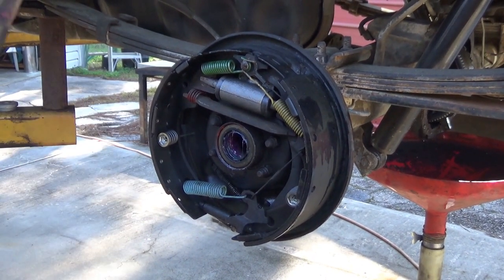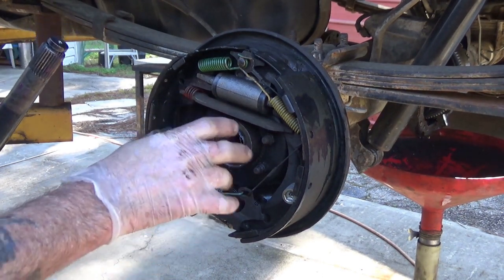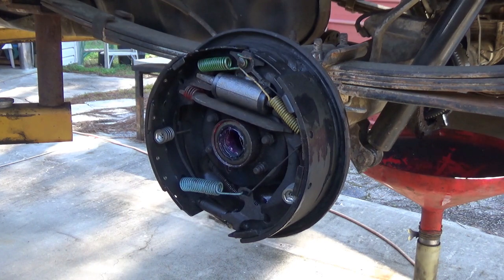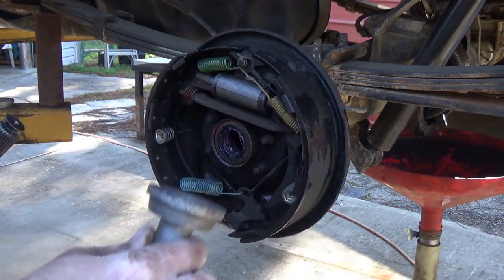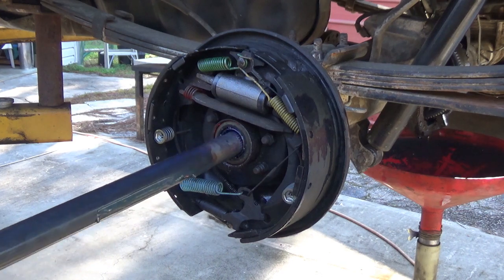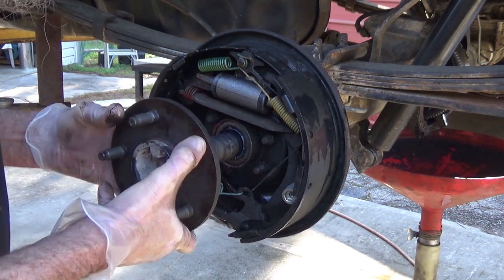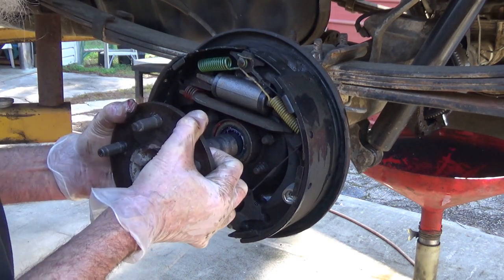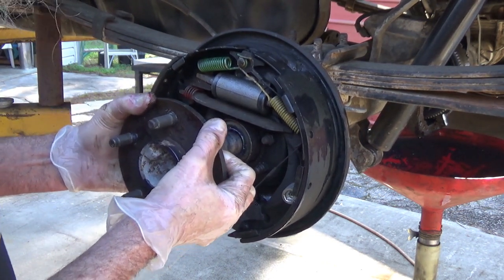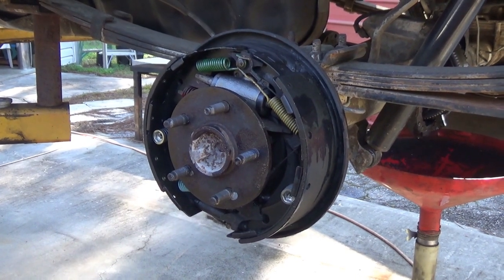The camera was off — I coated the bearing with wheel bearing grease and also the seal. I put the bearing in with a big socket and then used a bearing driver on a handle to seat the seal. So we're ready to put the axle in — got to get it in there and line it up with the gears inside. There we go — that's it. Alright, hope it helps somebody — talk to you later.